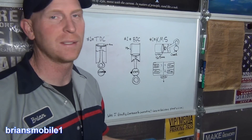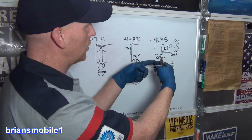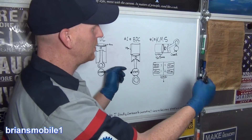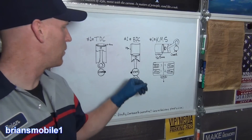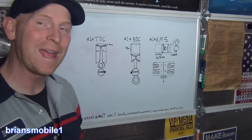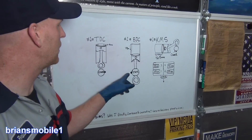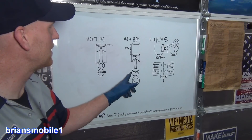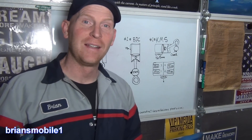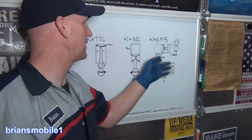When the pistons go out, the front two go out while the back two go in, and then when the back two come out, the front two are going in. So when they cross paths in the middle, right there at the bottom — when the keyway is at the left, you're at bottom dead center on cylinder number one. When it's all the way to the right, you're at top dead center on cylinder one and two because they go together. And three and four are at top dead center when these are at bottom dead center. I'm making it harder than it needs to be, but this is just nice to know if you're doing anything else.